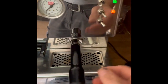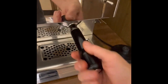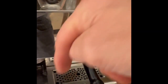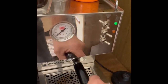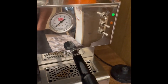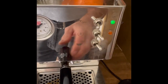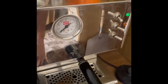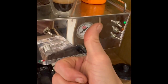Really pleased with that. So that's how you change the group head seal. Sometimes if that seal's going, you'll also start getting drips coming down the side. I also found out that the little screw in the middle has a spring, and what it should have is basically like a little nail — that acts as the non-return valve, not a ball bearing. I've ordered one off the internet. I've put a little screw in there at the moment and it sort of does the job, but that drip is because I haven't got the correct stopper in there yet. That's coming, and I'll change it shortly. Hope this video has helped — you can do it! Any questions or comments, send me a comment.